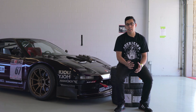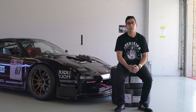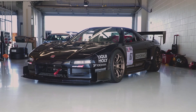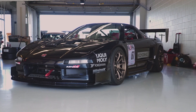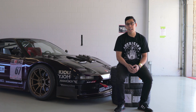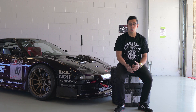The magic with this car is definitely in the handling, and a big component of that is the suspension. We've got it really well dialed in with a set of off-the-shelf KW Club Sport coilovers, which is a big shock to most people — they think the car has pretty trick custom dampers. We have basically changed the spring rates: we run 18K in the front and 11K in the rear, which is a pretty big departure from the factory rates the Club Sports came with, but it's stock valving and even with that valving it has excellent control. We're about 8–9K higher than what they came with, which is kind of surprising.